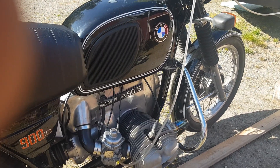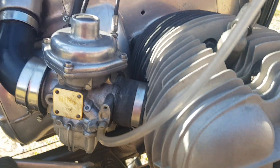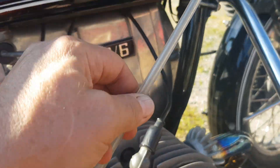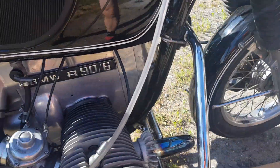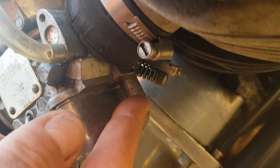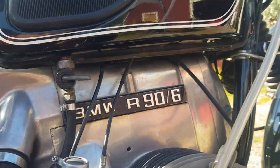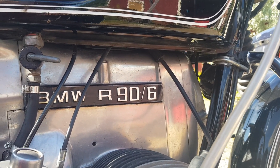Here is how I adjusted my carbs. I have a piece of plastic tubing that goes to a board and inside some ATF fluid — that's my manometer. First thing is adjusting the air screw, which is here. You have to set this at the rich side of the highest possible RPM number that you can achieve.